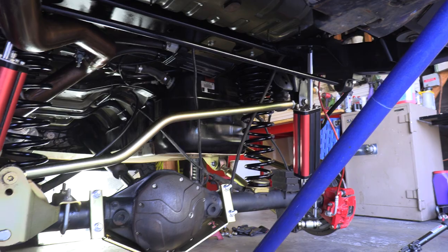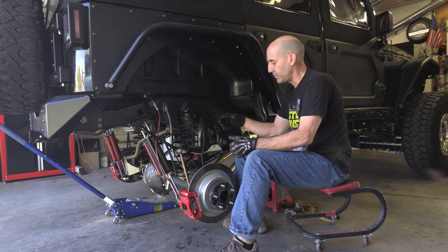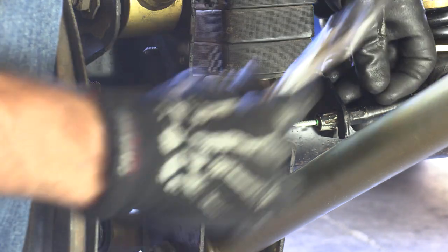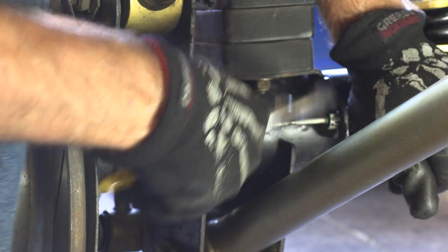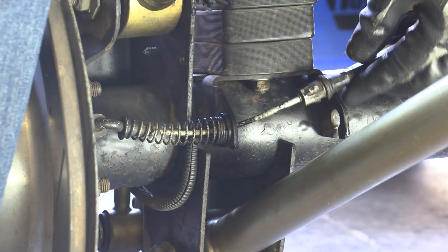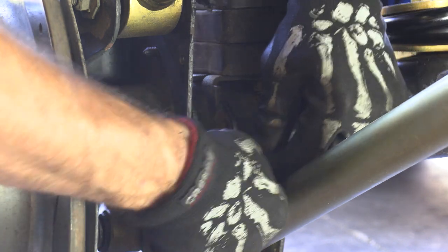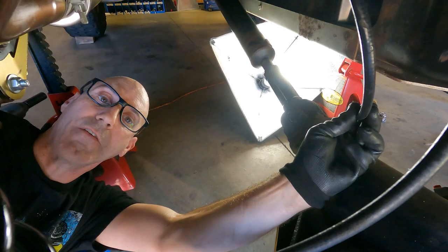I'll show you how easy it is to detach the end of the parking brake cables at the wheel, and then all you have to do is run those back underneath the frame rail and do your zip ties. The trick is to just release this clip right here, and that gives you enough slack to pull it out of the little loop at the end. I use some pliers and squeeze the little tabs to get that to go through — you may have to do it twice because there are four tabs. Pull that out, there's a little hole or release in the bottom, and that just comes right out. Then that gives you enough slack to pull the same thing out of the release. This little hook just goes in there, and you just reverse that process. Do this on both sides and that frees up both of your parking brakes.